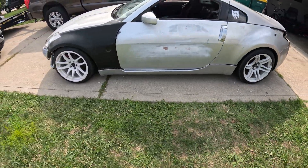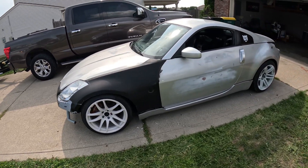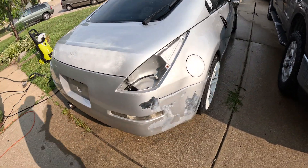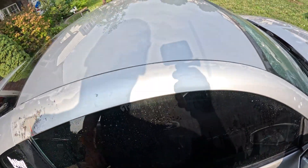All finished - it really sucked and took forever. We're gonna hose the car down, sand it up, and probably paint it tomorrow since it's getting late. I thought I had sandpaper but I only had a couple of sanding blocks, so I pressure washed the car really good, did a wet sand, let it dry, and tried to scuff up the clear coat. I might need to get more sandpaper. You can see where it's drying it's kind of dull - it's all scuffed up.